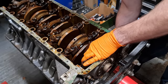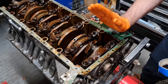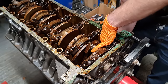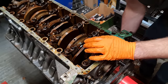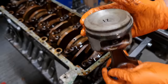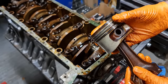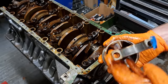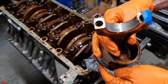Now I'm going to remove this piston. Got to put a small bit of tape on the inside edge because the rod actually wants to naturally fall over this way against the cylinder wall. So I'm just going to do that now. Okay, the piston is now free and it should slide down fairly easily. And as I say, that's piston number 12. And that is the condition of this piston. There is 133,000 miles on this engine, which I forgot to mention. And once again, let's give this a light rub. There's certainly a bit more noticeable wear on that one. But again, absolutely nothing to...